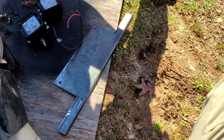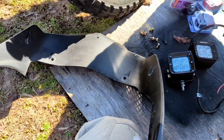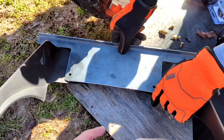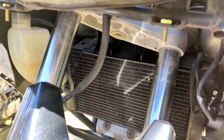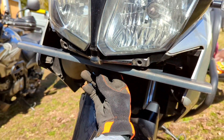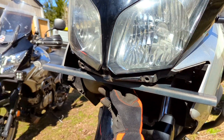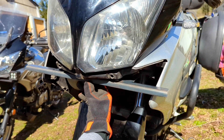There's pretty much the finished product without the paint on it. You can choose any color paint you want — green, red, purple, blue — we're going to paint it black. How we got the two holes for the mounting area: we took the plastic cowling, held this thing up here, went up underneath it with a sharpie, and just marked the holes. When you get this thing off, you just put two quarter-inch bolts in there. You've got to do all that while the plastic cowling is off, then you'll see it sticking out there. You can choose however far out you want to mount your lights, and we'll show you once it's all completely bolted up and painted.